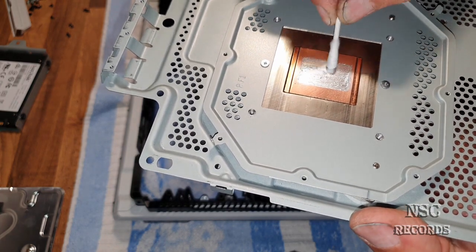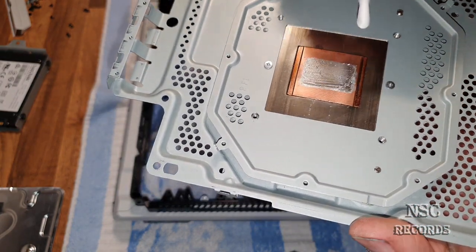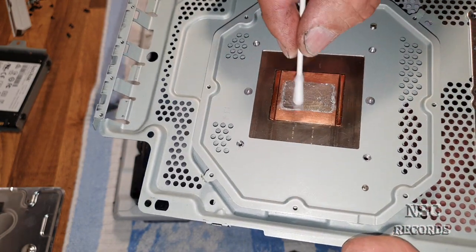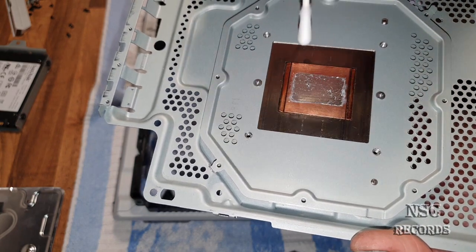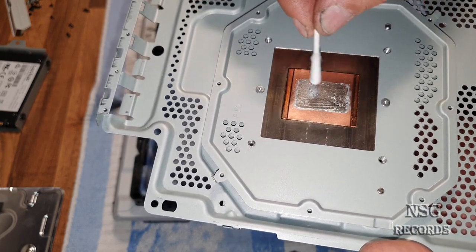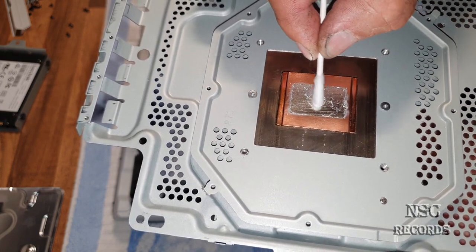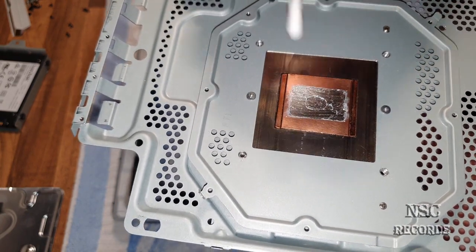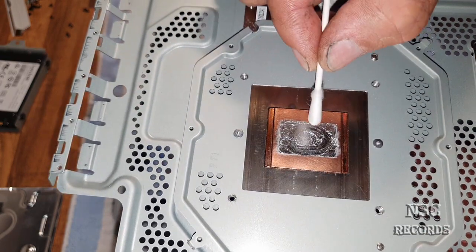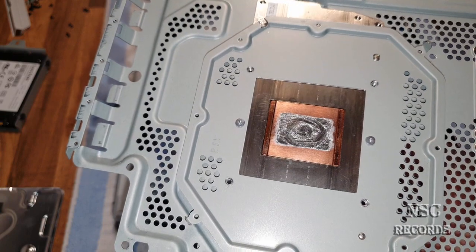All of those are just fine for the PlayStation. And if you have some overheating problems after you have applied new thermal paste, you should check if your APU or CPU really has contact on the whole cooler, on the whole surface. Because if your APU or CPU has just contact in the middle, of course it's going to be a little bit hotter because all the rest is just not cooled. So if your CPU has just contact here in the middle, this is just not enough.